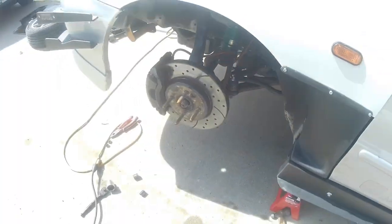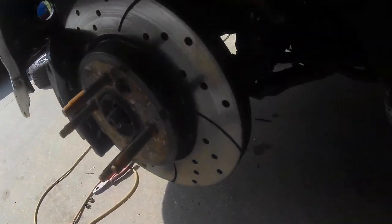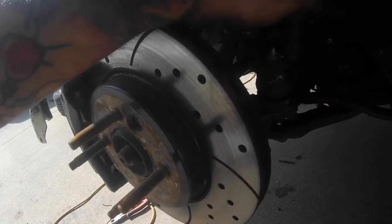I did the oil pan and stuff last video, so right now I'm going to go jack up the car and pull the wheels on both sides. I need to undo the axle nuts because I already have the ESM lower extended ball joints in there, and you have to take the axle out in order to take that off. I got the wheel off — undoing the bolt for the outer tie rod on this side.